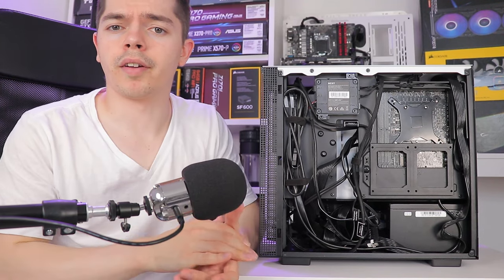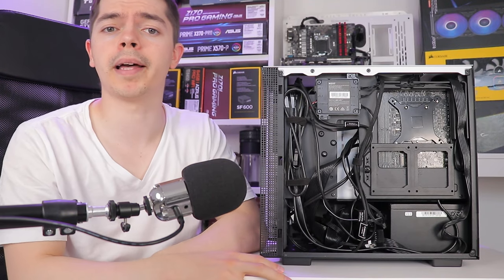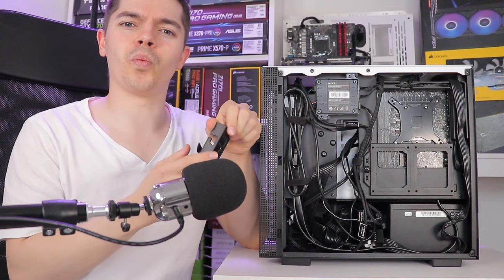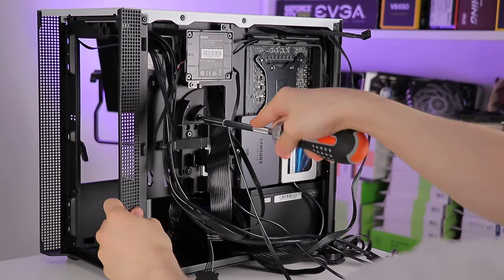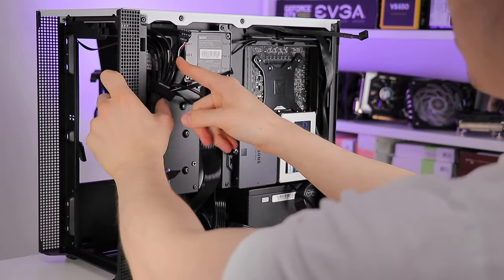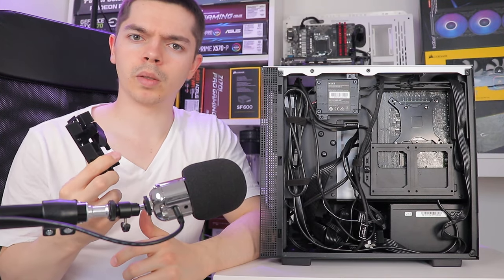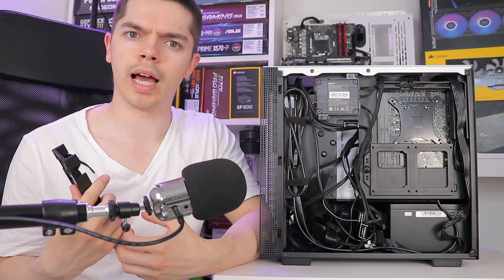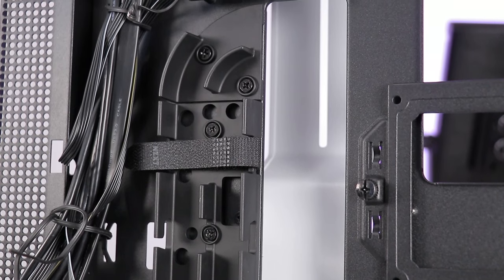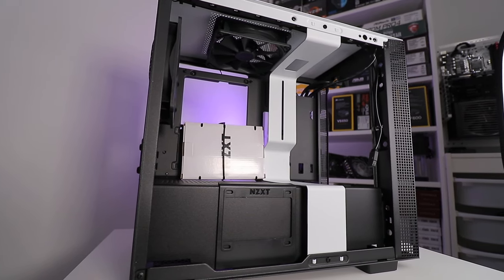A few notes about cable management. Since the basement drive support is limited, there's loads of room for cables to be stored, which helps a lot. In terms of managing cables with loops and straps, NZXT have a couple of plastic channels — one to the centre of the case and another to the top. My thoughts on these are similar to my thoughts on piles — they're kind of a pain, stick out like a sore thumb, and my experience is it's far better without them. What are these plastic walls doing that velcro straps don't allow for? They really limit the flexibility of routing cables while not really adding much value.